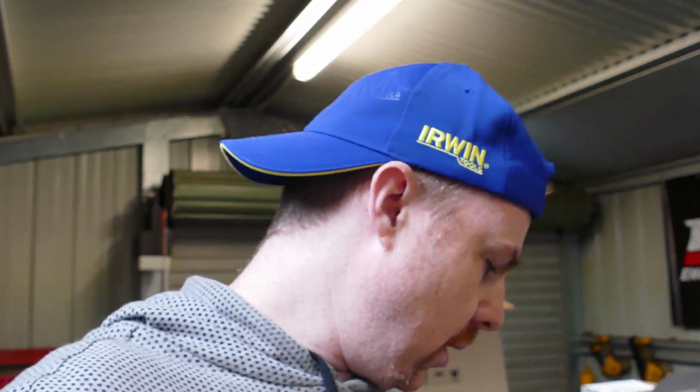I don't know if people understand that about slick tyres, but ever watch a video of a top fueler, you'll see the tyres get taller and skinnier. That happens with all slick compound tyres. Cross-ply tyres do that. So we'll need to check the clearance all around. It looks okay, but who knows? Got to check it out. Got to find out before we go at hopefully somewhere around 150 mile an hour potentially. I'd rather it happen at really low speed than at 150 mile an hour to have a blowout on a cut tyre or something.